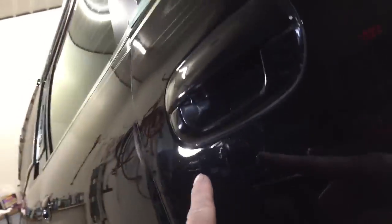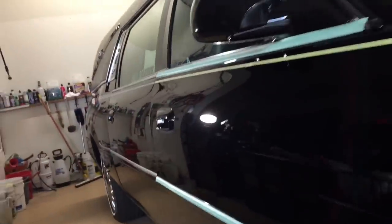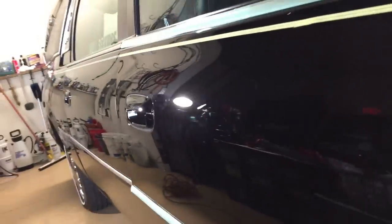Using my unforgiving LED here, I'm going to try to show you a few of those - here's a cluster, and there's two more clusters of swirls left behind - more like love marks from washing the car. Those are in a straight line. However, I do want to give you the overall picture: it's done a lot of work, it's done a decent job. You can see the condition of this door we have yet to go over versus the one we just finished.